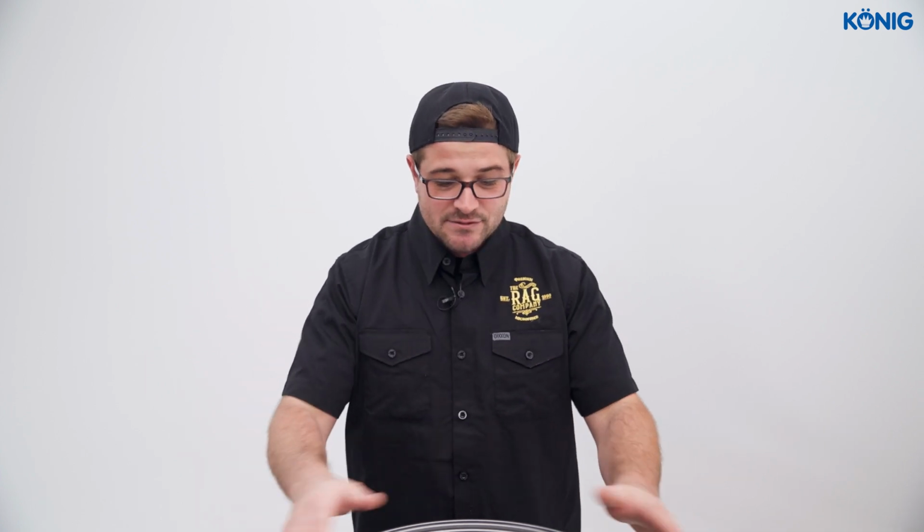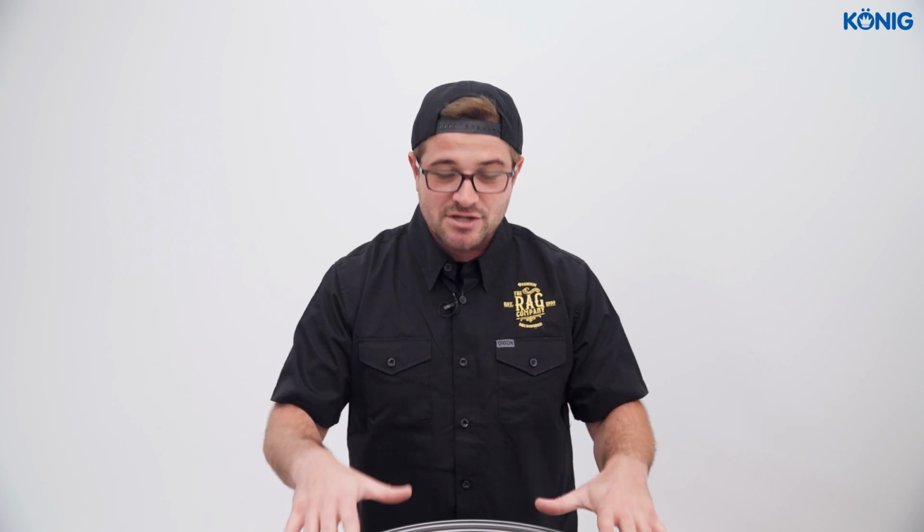Now, one thing to note is that if you haven't had your tires mounted yet, do not coat your barrels, because once they go to get balanced, that wheel weight will not stick to them if they've been coated. So in today's case, with my bare wheel here, I'm just coating the face of the wheel. Once the tire gets mounted, I'll coat the barrels. Otherwise, you can do everything at one time once the tires have been mounted, and hopefully that'll make things a little bit easier as well.